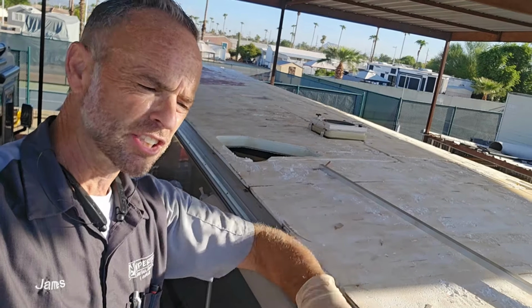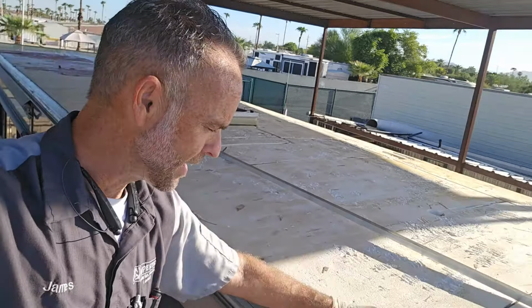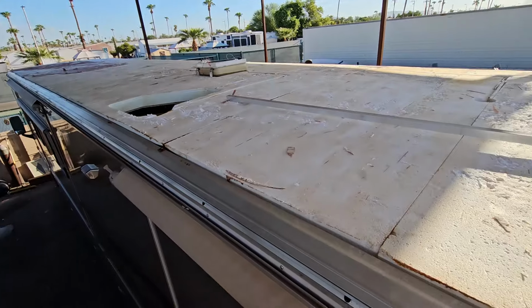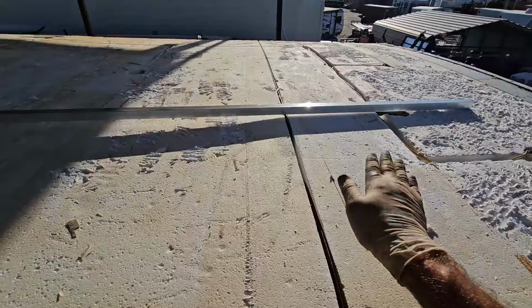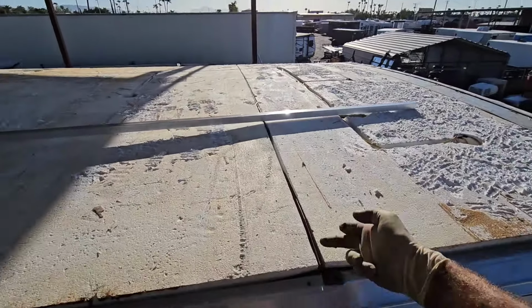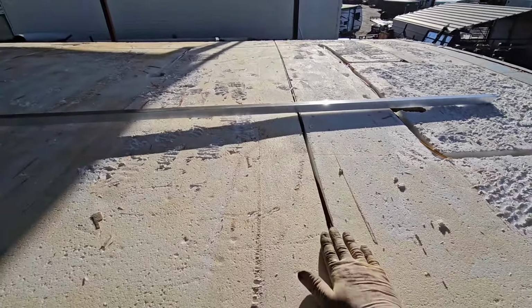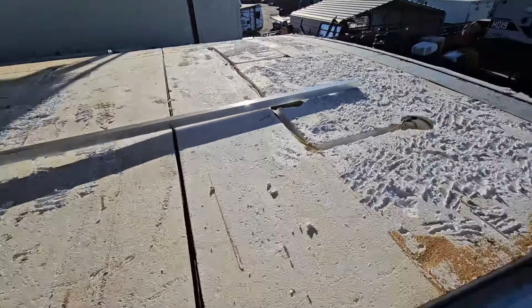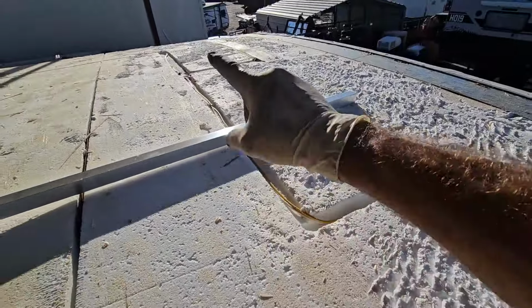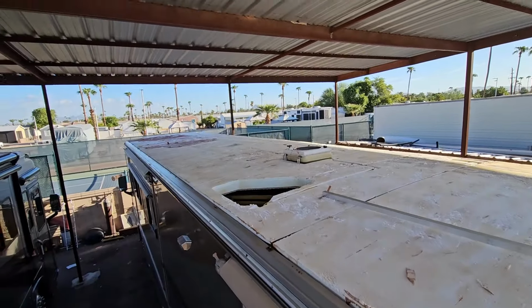And our improvement process isn't just limited to putting support underneath. On all the coaches that we work on, we now stitch and glue all the styrofoam together. It's been a learning process, but we found that adding expanding foam to actually glue each one of these pieces of panel to itself gives a lot more structure. And if we add up all the square footage of all this voided space, it becomes glue space. It adheres to the Luan a lot better, even with the wire runs right here. If you start actually adding up all the square footage of that missing voided space, it becomes pretty substantial.